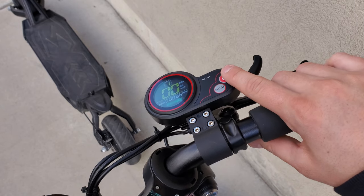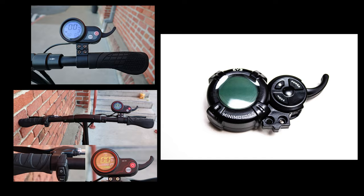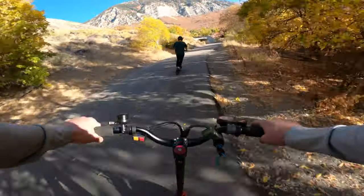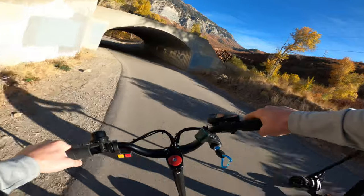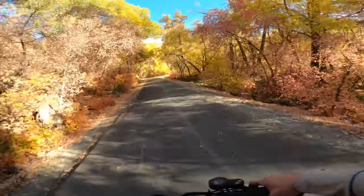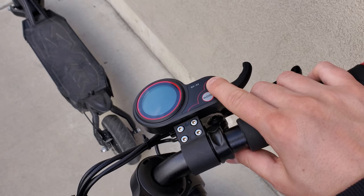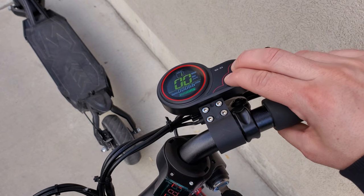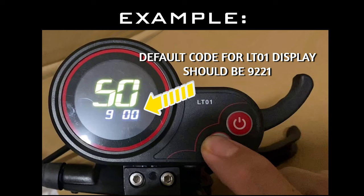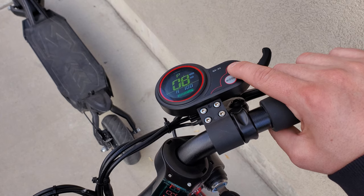The last thing to check and adjust before taking the scooter out to bed in the brakes is the adjustment of the P settings on your throttle display. P settings tell the controller how to operate the scooter based on the size of the motors, size of the battery, how quickly you want to accelerate, if you want to use kick-to-start, and other factors. Most scooters will either come with the correct default P settings or with instructions on how to set them up. Turn on your scooter then hold both the power button and the mode button at the same time for a few seconds. Controllers that aren't already set up will ask for a passcode — there's a default code you can find online based on your model number. Once you're in, you can either set up the P settings or double-check that the factory set them up correctly. I'll put a resource for the P setting adjustment in the description.